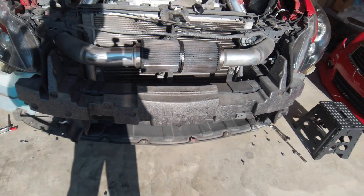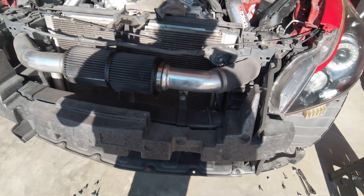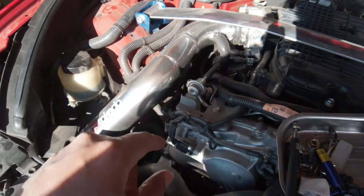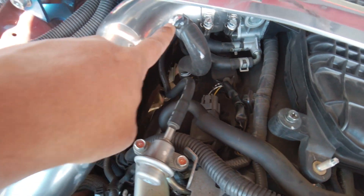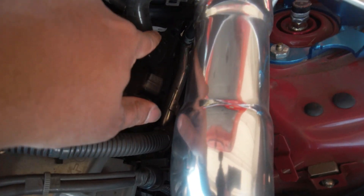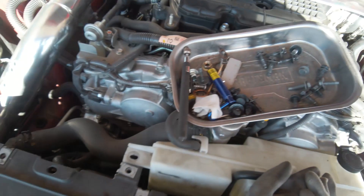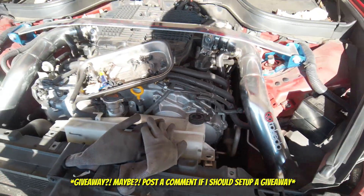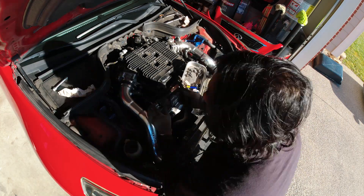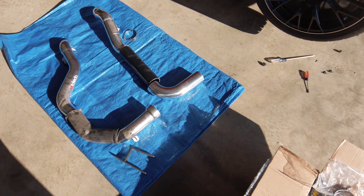I did a dual intake mod that I really liked, but we're going with three-inch so we have to get rid of these. We've got to disconnect the tubing, take off the strut bar, and cap off the valve breather because the three-inch doesn't have an inlet for the PCV system. These intakes are only a few months old — I waited two to three years to buy them and now I'm taking them off the car. Go figure.